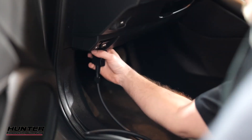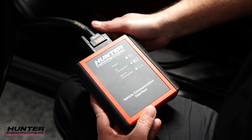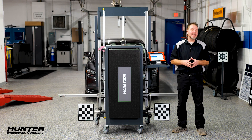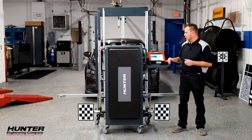One of the reasons why is that aftermarket glass can skew or cause a miscalibration on your camera. So we've got a new windshield installed on our Mazda and we're going to go through the process of calibrating that front camera. We're dealing with a 2020 Grand Touring Mazda 6, and this procedure will apply for all Mazda vehicles currently on the road right now.